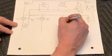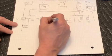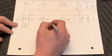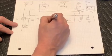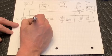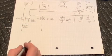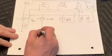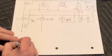With the fuel pump, you're going to do exactly the same. It's going to go to the battery, and you're going to have a 20 amp fuse in line. And then as 2 optional fuses, you could add what would probably be like a 30 amp fuse. The relays are good up to 40, so you could go that large as long as you run your wire size correctly. But you could run a 30 amp fuse to protect the relay, but we are fusing everything downstream, so that is kind of your choice if you want to protect the relay from that load.